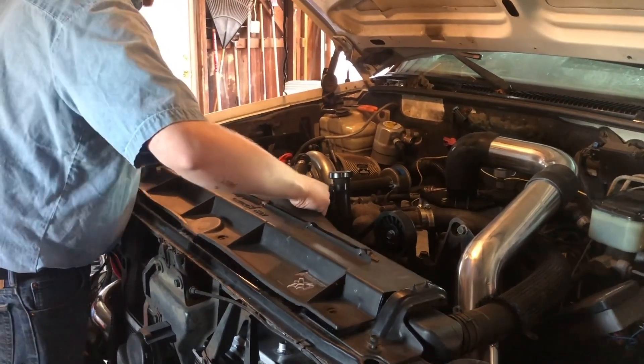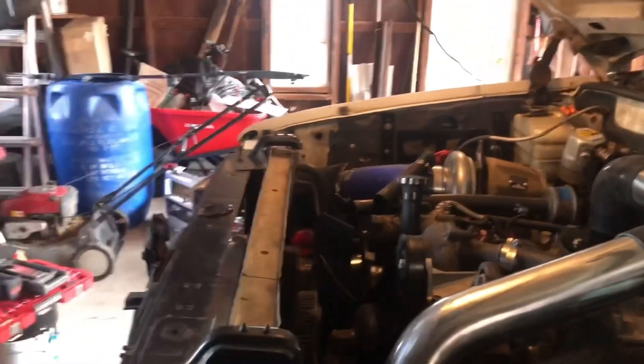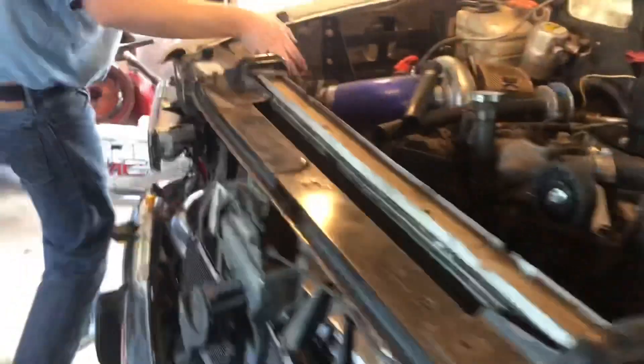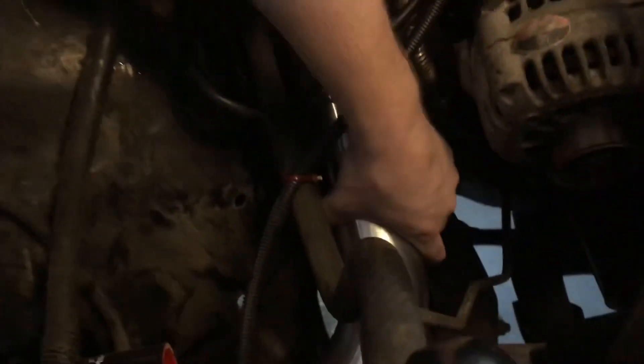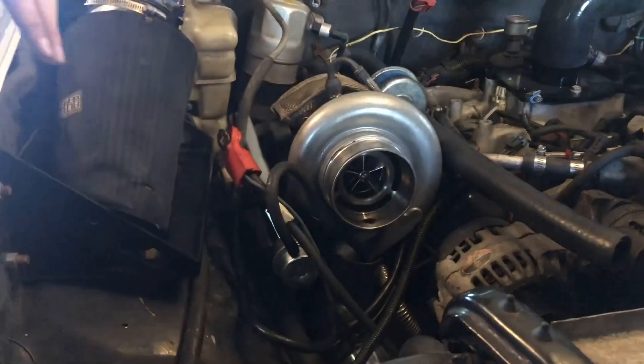Here's all the fun of mock-up — keeping everything loose so you can get it out of the way. You can look down inside and see kind of where the charge pipes are going to go and how they'll protrude through the core support. We'll have a 90-degree boot here. On our hot side, same kind of thing, just a pipe laying in place. So the plan is: 90-degree boot off the intercooler through the core support up to the turbo. And our Super 54 Billet 5-blade here will get a nice new 90-degree boot put on it. Then we should be in business.